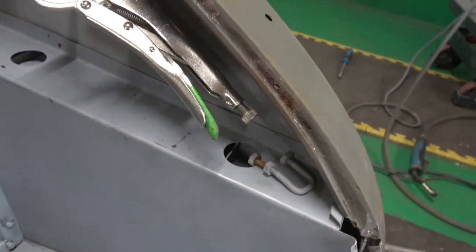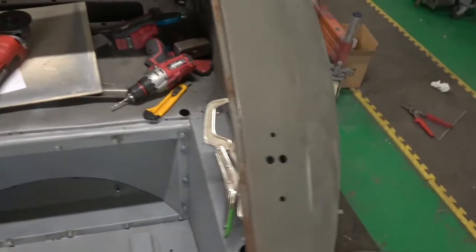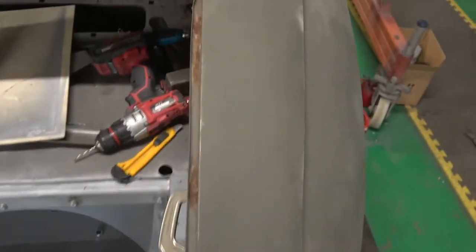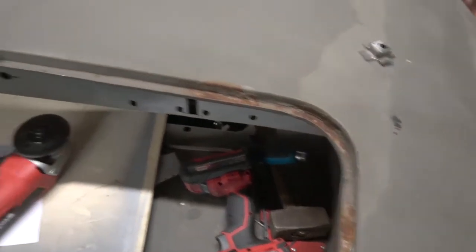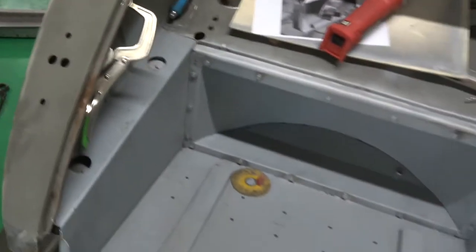They're going to be welded in, but they won't be welded in until we've got everything sitting right. This tonneau has to be redone — you can see all the surface rust. Two and a half years ago it was sandblasted, but there were bits that have come back through, so I'm going to have to take it all back to bare metal and obviously these ends need repairing.